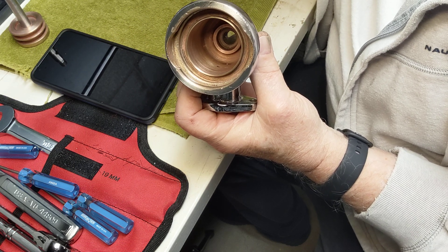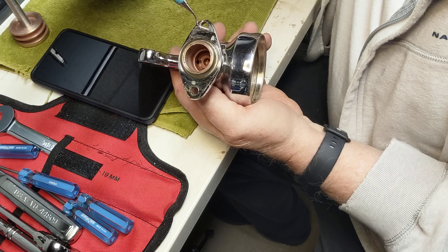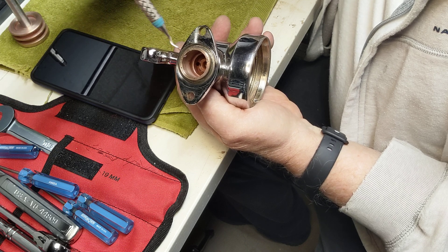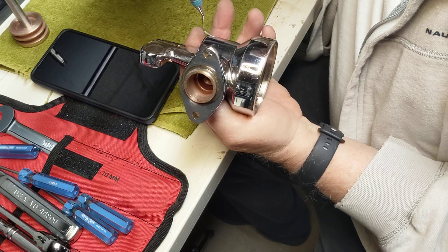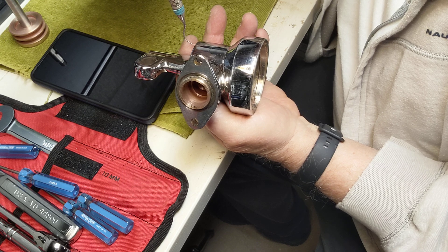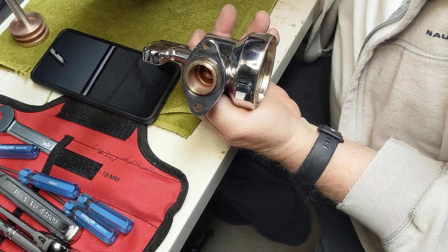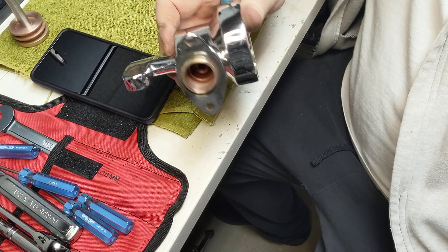This whole group head is steam heated, which makes it heat up fast and is hard to control. What the boiler isolator does is two things: one, because it's made of heat-resistant nylon, it isolates the group head from the boiler. The other thing it does is it seals off that steam hole. Now hot water enters through the three holes, so the top part of the group head is now heated by hot water and no longer steam — it's not as hot and much easier to control. Water enters in those two holes into the brew chamber, and above the piston through this hole here, hot water enters in. It's a much better construction. Hope that explanation helps — maybe I can explain a little bit more when I get there.